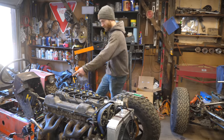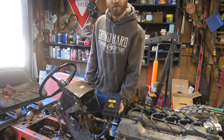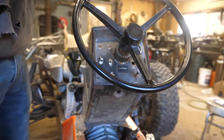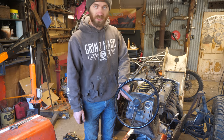I wired that all up, ran it back through here, and hooked it up so that when you turn the key on — also we've got the Elite 2500 plugged in now — if you turn the ignition on, the ECU powers up, runs the fuel pump for a few seconds, and then you can turn the fan on. All good things. I wired that to a switch that fits in one of those spots on the dash, so we've got all our switches looking old and tractor-y. I also realized we absolutely need to wire up these two lights as our only indicators on the whole dash.